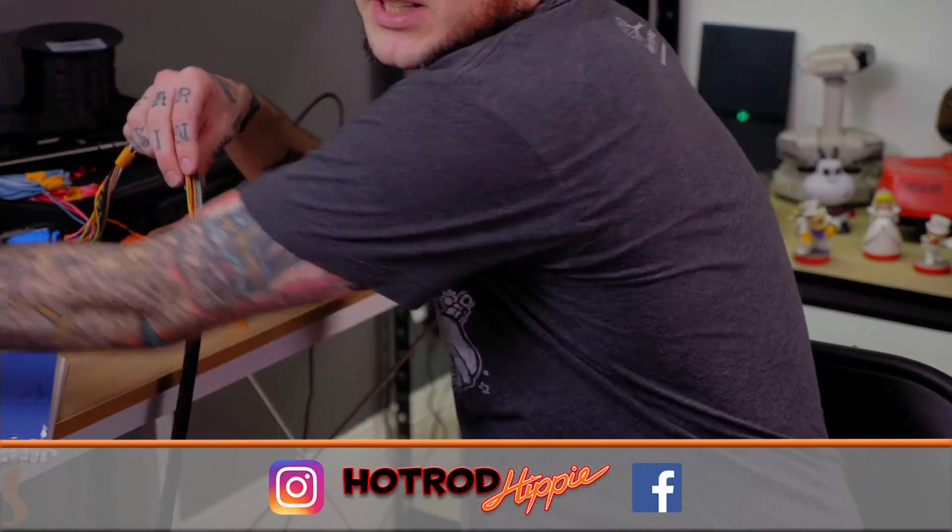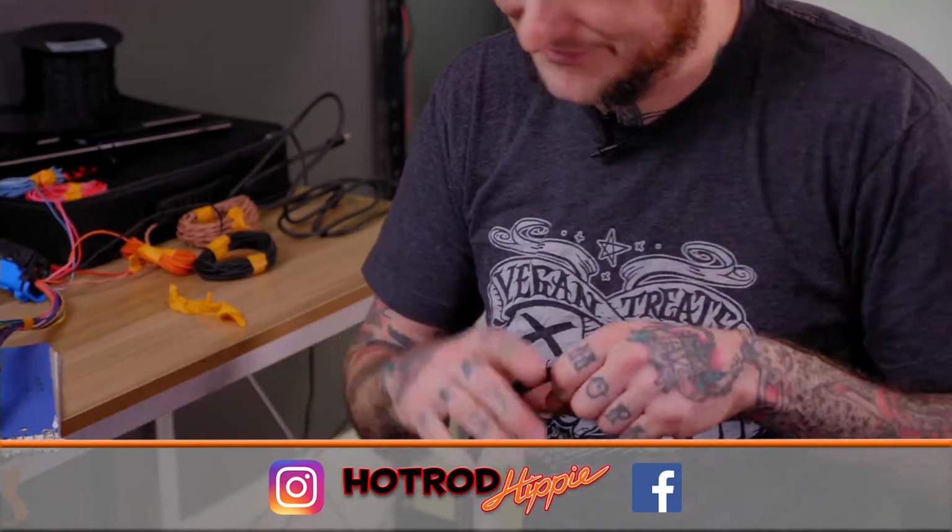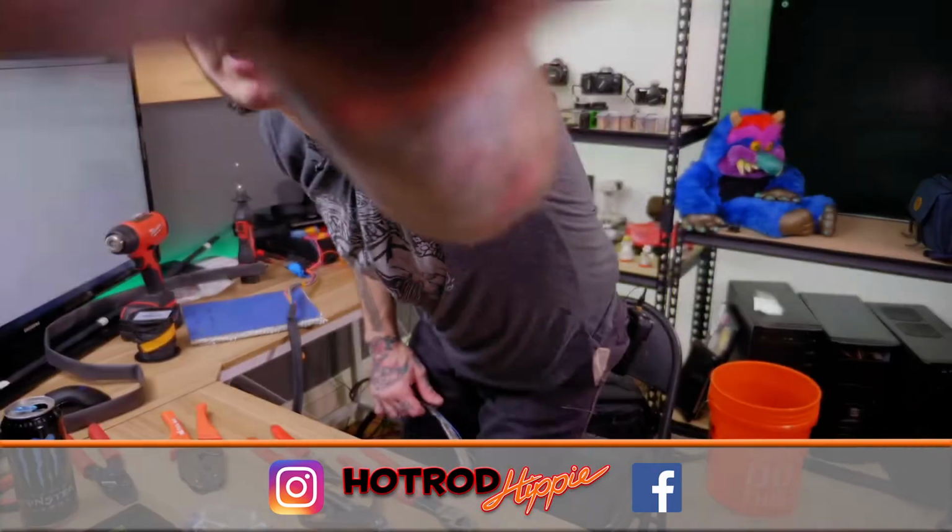Using the L96 out of a 2010 Express. Yeah, it is the poor man's LS3, but honestly, there's not a whole lot of difference between them. You still got excellent flowing heads. Aren't the L92 heads the same as the LS3? I believe they are. Probably different valve springs and obviously a different camshaft in the motor, but no, a good combination, good setup.